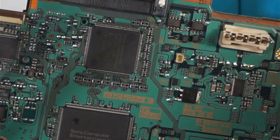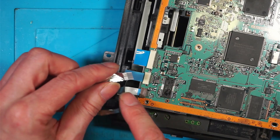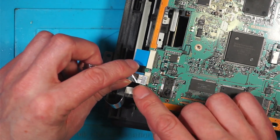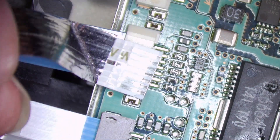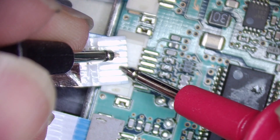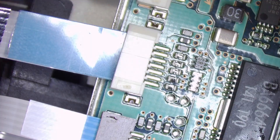The CD drive is not getting any power. Here's the cable - it could be a faulty cable, so I could test for continuity between these pins and the pads on this ribbon cable. That's the end of the cable - one, two, three, four, five, six, and seven. So there's nothing wrong with the cable - we'll have to look elsewhere.